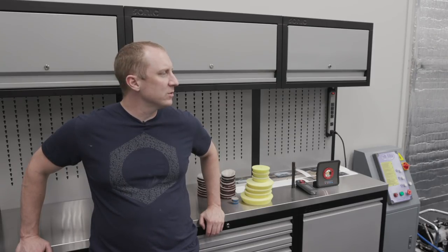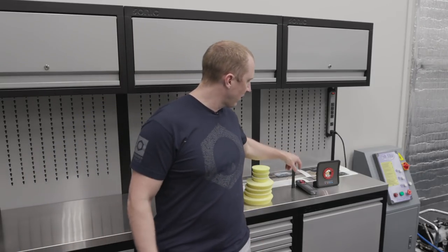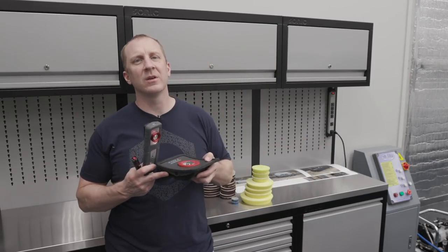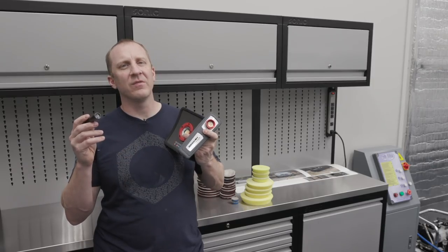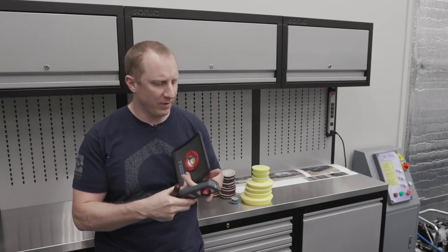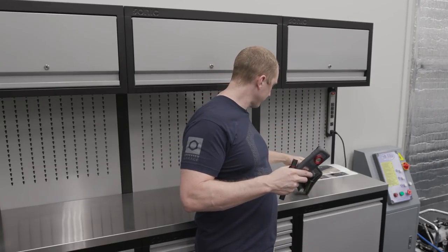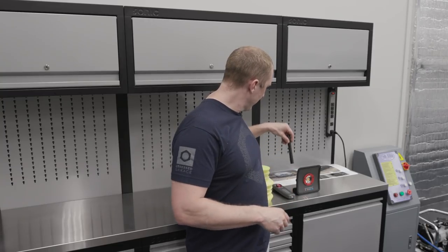So anyway, this was a fun little polishing project. The other things we used were these three Scangrip lights. I think I have a package in the store, but just go to Detail Lighting. So we use these three lights. The Phoenix light doesn't work as well on white because this one will change color temp from 3,000 to 6,500. And then these will go all the way down to 2,500 Kelvin, which is extremely yellow, which helps on the white surface.